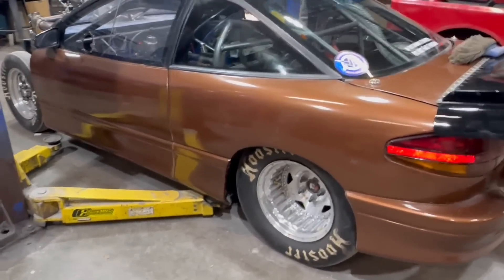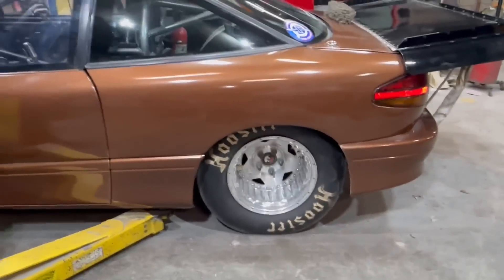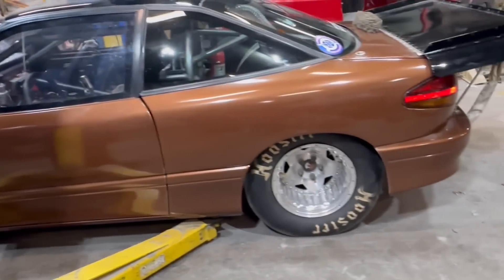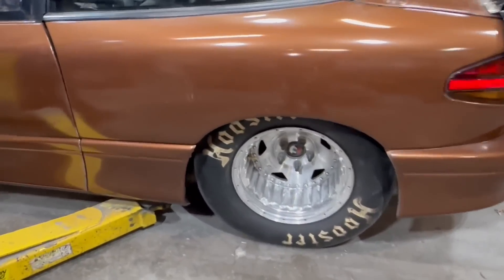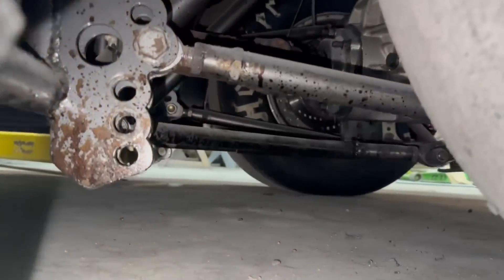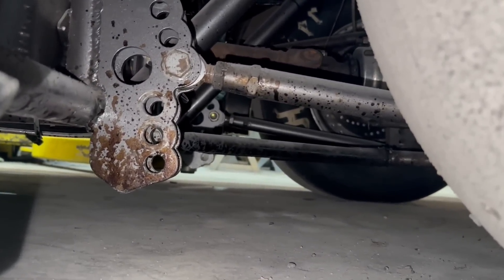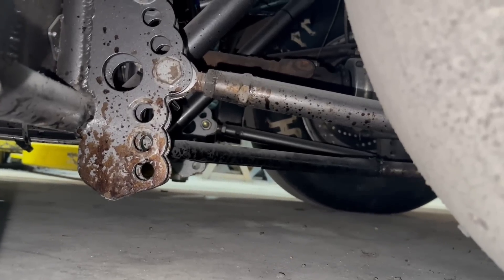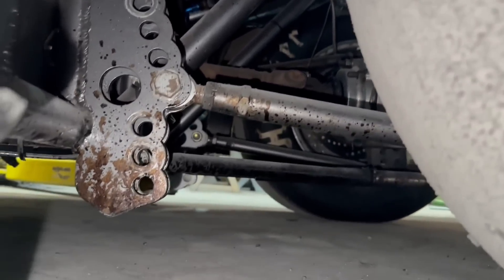On a small tire backside you don't have a ton of power and the surface is kind of rough usually — that's what you want to do. When you go frontside you have to make a change. So this is about the ride height we want to be at — it's not super low in the back, we don't have all the weight in like we do for the backside stuff. We took some weight out, so what we're going to do is move this bottom bar down. You can see it's not really in the natural location — in order to get enough uphill rise at the ride height we had, we had to move it up to that hole.